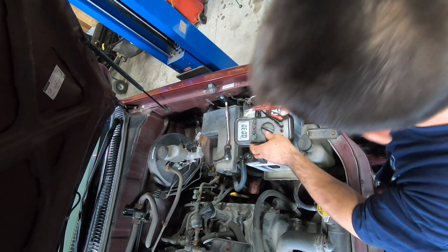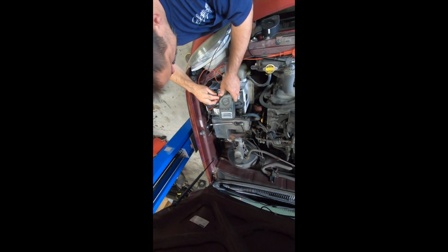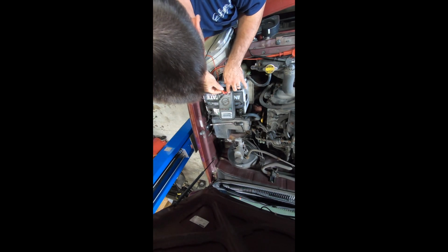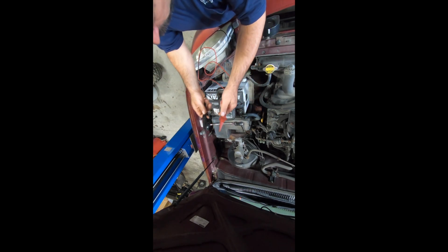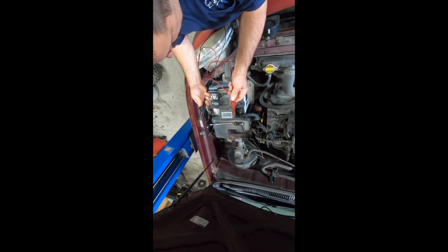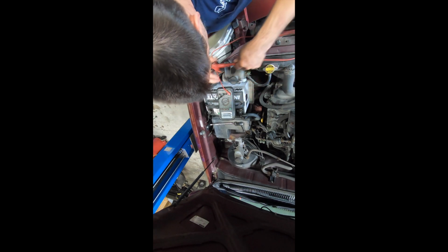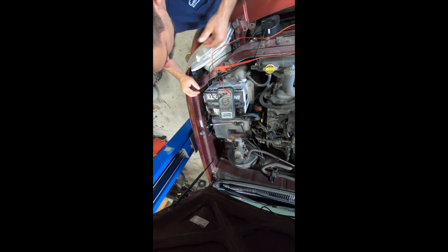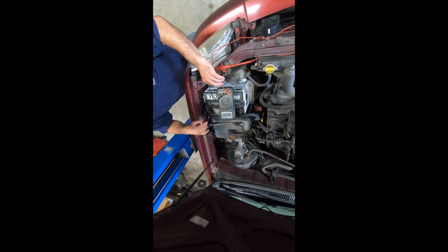So now I'm going to be doing amps, so we're going to set it to the amp setting. All right, got it set on amps. Got to take the plug out and put it on the amp setting. Now this, in effect, becomes a jumper wire. You don't want to blow the fuse, because then you waste a few minutes tearing your meter apart and replacing it.